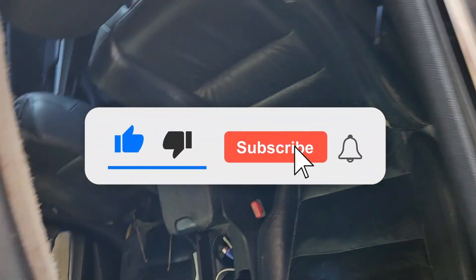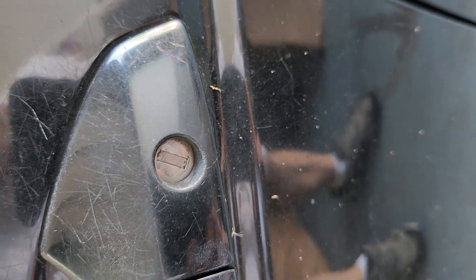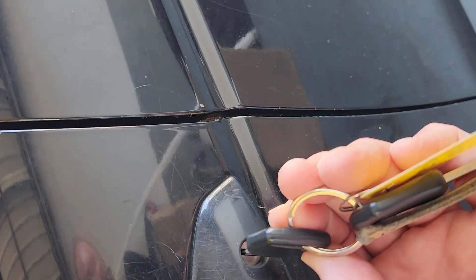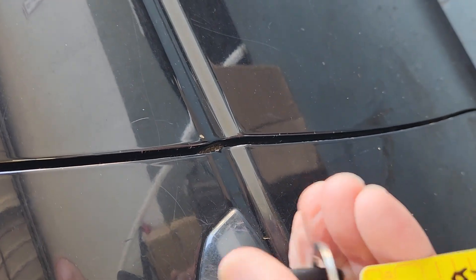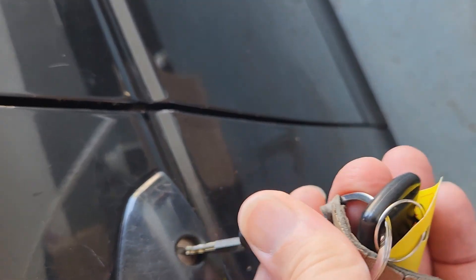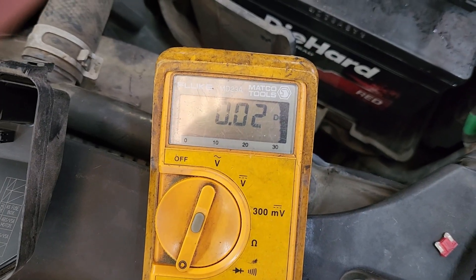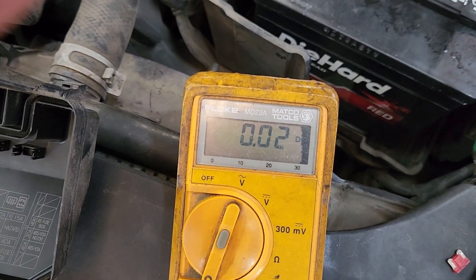Did a little bit of research and found out that the driver's door lock switch is a culprit in many cases. I came over here and that thing is askew. I'm going to try sticking the key in there and turning it back straight, which it will not do — we may not have the right keys. I believe that's going to be the problem, so now I've got to get with the customer and find out if they want me to actually fix what's wrong with that at the driver's door.